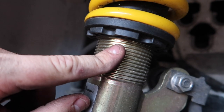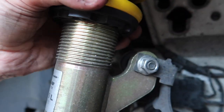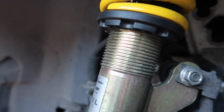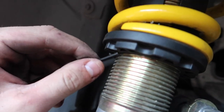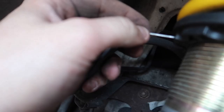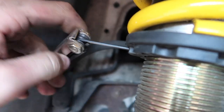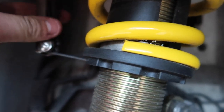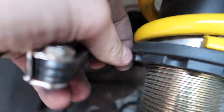On the other side there are 14 rings; right now I'm at 12, so I raised it two rings. Going to 13, then one more to 14. Once done, put the Allen key back in the little hole and tighten it back up — super simple, unlike coilovers with two adjusting collars. Just make sure it's hand tight and you're good to go.